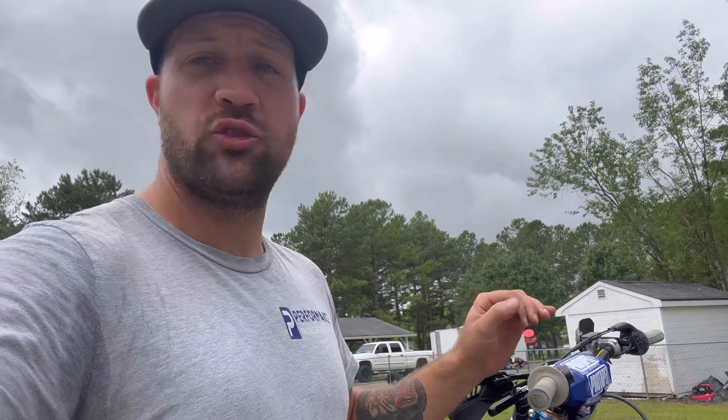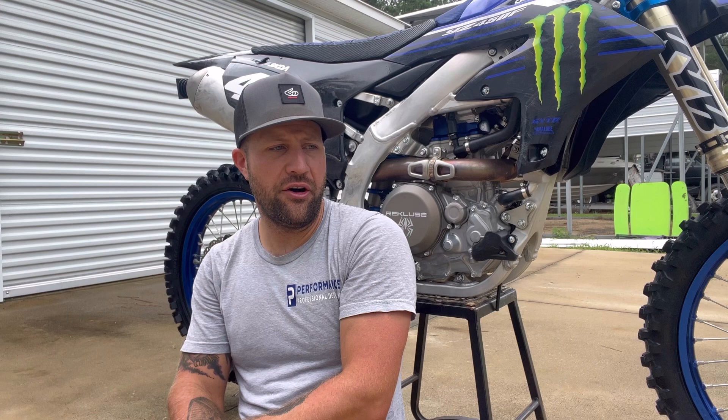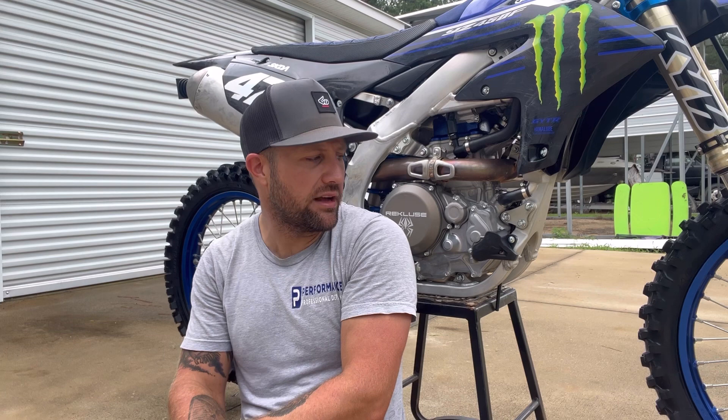A couple things I want to talk about with this bike — I'm just sitting here chilling on the concrete leaning up against it. At almost 30 hours I still haven't gotten the suspension completely figured out. I came from a Kawasaki, the 2021 KX450 — for me that thing was like a pontoon boat, you just float around on it, real easy to ride. This bike is real finicky — one or two clicks here or there, one millimeter here or there, it reacts to every little thing. I'm 35, 5'10", 180 pounds, fairly good shape, and I'm stock on everything in the suspension right now. I've only changed the sag number, clickers, and that good stuff.